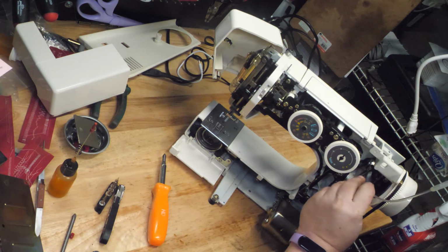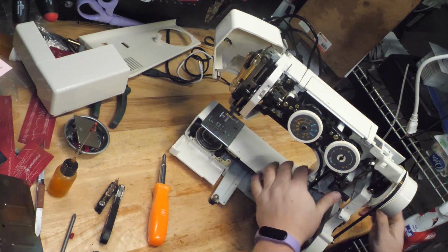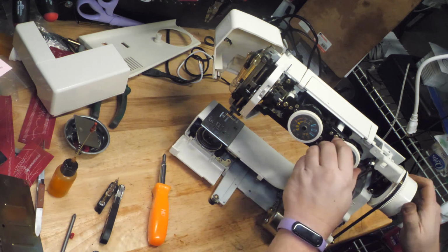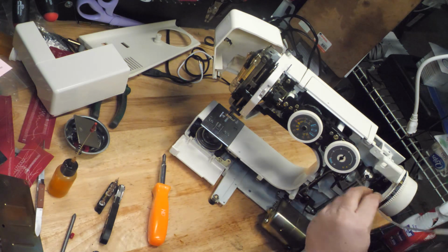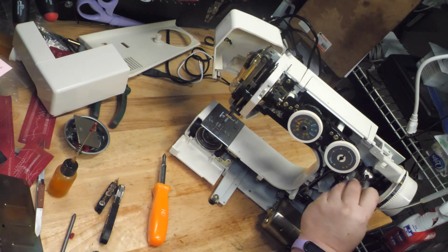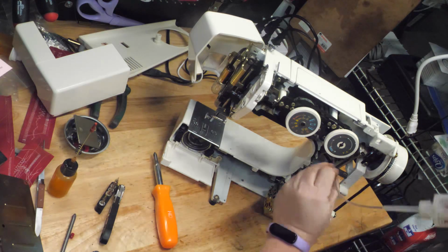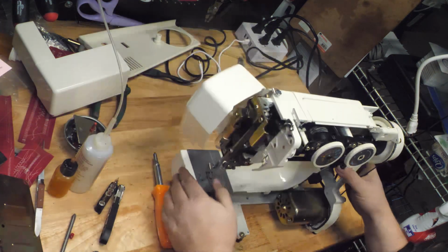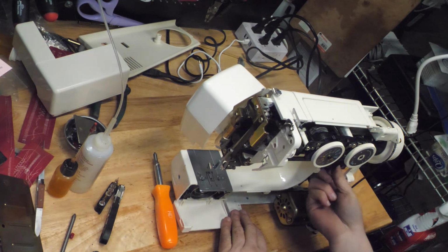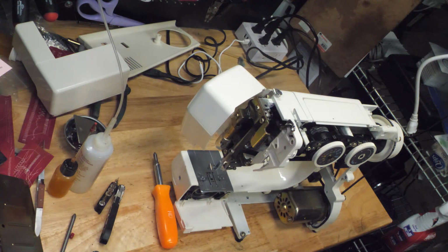And then our zigzag, or our reverse block. We'll just get some oil on that. This is, again, a machine that they applied grease to as a long-term lubricant, but that grease has expired and needs to get rejuvenated with some oil and replaced and cleaned out. So that's how to pop the cover off this, and I'm going to be back after I'm done oiling it.